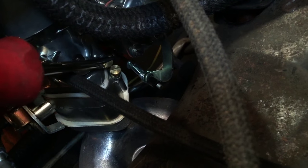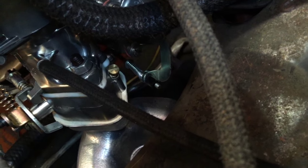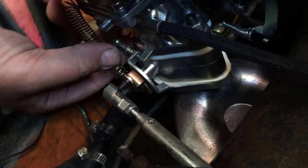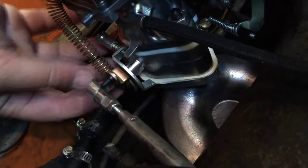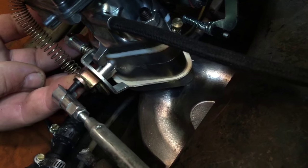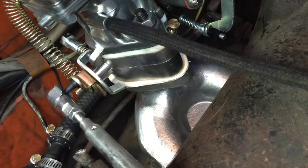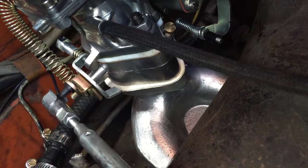All the other adjustments on the carburetors are really the same. You'll see on this side your mixture screws right here — look at the videos, read the installation tuning manual. Your idle speed screw is back here. It's a little different but it's the same carburetor. You'll notice also that the linkage lever is on top. If we built the carburetors here for you, you've already got these things pre-installed. You tune them, sync them, do all that stuff, just like you would on a Type 1. Look at our other videos to see what we've got going on there.